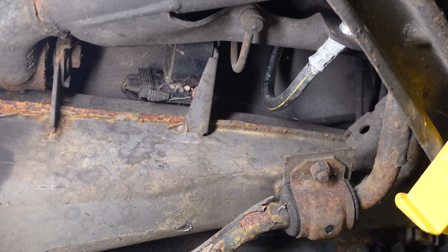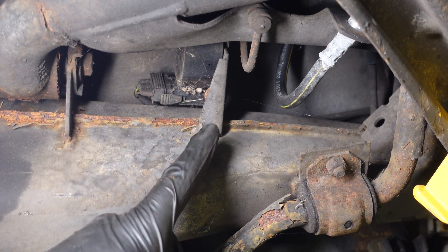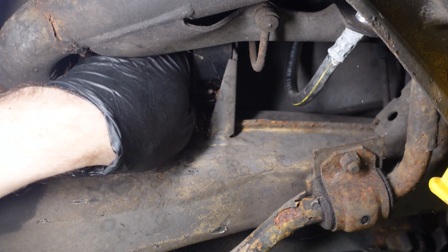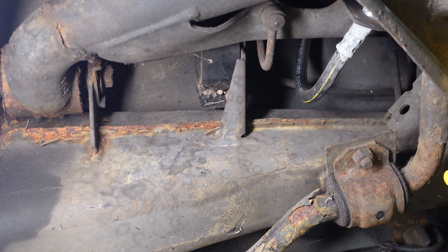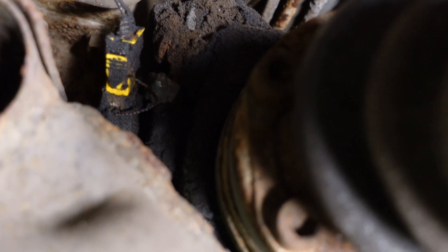This is the SLS level sensor. This will tell the cluster that the vehicle is too high or too low — it gives you that SLS error message. The sensor itself is attached to the subframe, so we're not going to mess with the sensor or the rod. What we're going to do is unplug it because that harness goes to the chassis, and we can just leave that up here. Next we have to contend with the vehicle speed sensor. That plug goes into the back of the differential and the harness goes up to the chassis, so I just have to unplug this.